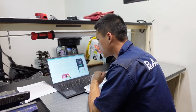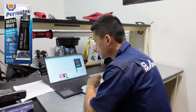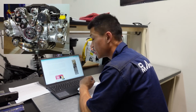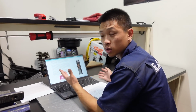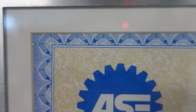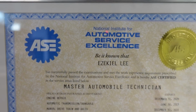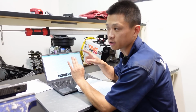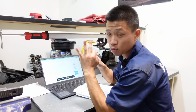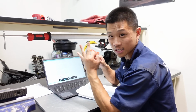All right, so just reading directly from the article, 2022 GR86. RTV is a sealant used as a gasket for the Subaru FA24D engine. So yeah, absolutely. When Subaru went to all chain engines, back when I was a technician, silicone's everywhere. They pretty much got rid of almost all the gaskets. So valve covers have some silicone. Cam carriers, that's all silicone. Front timing cover, of course. Cam carriers are actually a three-piece thing too, with three-part silicone.